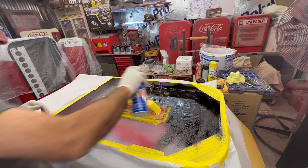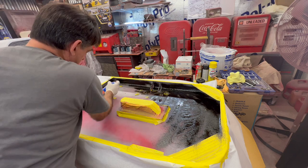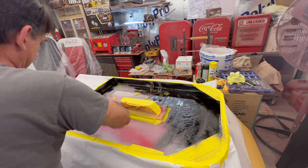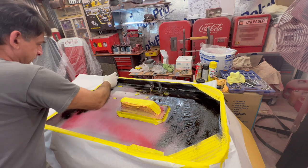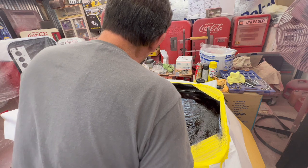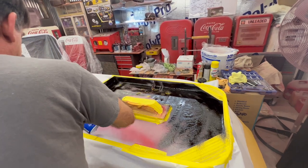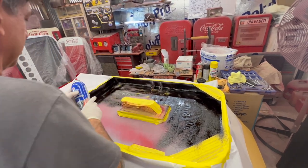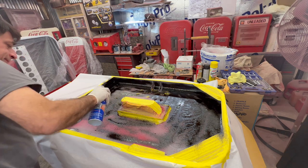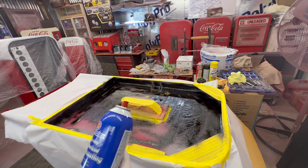You've got a little bit of a window for clean up, so make sure you've got gloves on — this stuff is sticky, sticky, sticky, hard to get off. Get those corners, especially down here. This is where most Vendo 39s have their moisture issues, right in this area. Not usually up top, usually all down in here, so get that coated as best you can. I've already got an epoxy primer on this, so I'm giving it a little added protection.